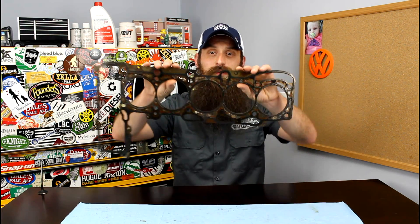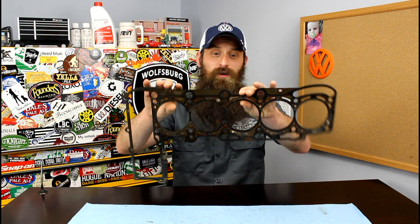But in all that, I have really good news. In 12 years, this gasket is the very first leaking cylinder head gasket that I have ever replaced. So it is not a common failure. It does happen — I've talked to other Volkswagen techs who say they have replaced these parts from time to time for things like leaking coolant into a cylinder or leaking oil. But again, it's very rare. Really the most common one I can remember in the history of my career is the Mark III VR6 engine, the AAA engine code VR6. That was actually a paper gasket, whereas these are metal and also have sealant embedded into the gasket. So they used to be a more common failure, but now it's a really shocking thing when we find out that a head gasket is leaking.